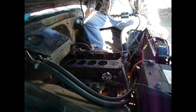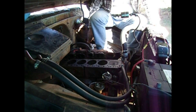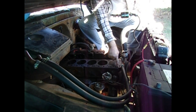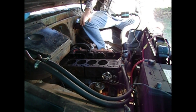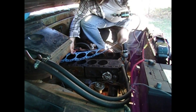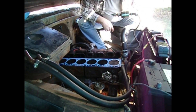To avoid getting hurt while putting the head on and to get it on straight, I'm trying some new things I usually don't do. For one, I'm actually in the vehicle — I've avoided putting my feet where there are wires or a brake line, there's plenty of space. I also have to watch out for the radiator core. There's a pin here and a pin here to help guide the head gasket, keep it in place, and guide the head down, because it's important not to move things around and destroy the head gasket. I'll put the head gasket on first, line up the dowel, and make sure everything's in place. Holes are now lined up and I'm ready for the head.